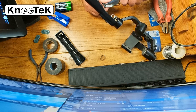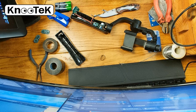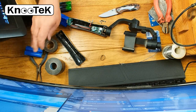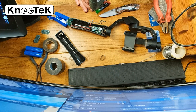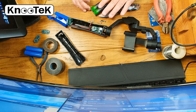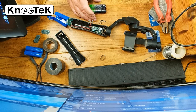You could wear gloves, but I can't because I've had carpal tunnel operations and still have problems with my hands. As you can see, that end is positive and that end is negative. Now the glue is dry so it's holding the batteries together. I might add another bit of glue on this side to secure it further. Be careful where you leave the glue gun - it can tend to dribble. So that's the battery pack kind of ready to be re-soldered into the device.